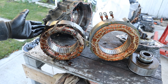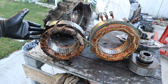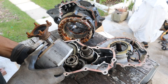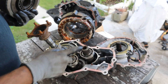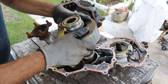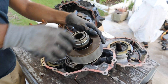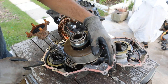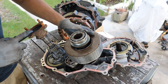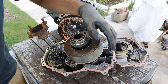MGR doesn't really do much in terms of propulsion — maybe a little bit on acceleration. Overall, you can see that this rear transaxle is quite under-designed; it's really just there to put an E all-wheel drive sticker on the back of your vehicle. MGR, represented by the rotor, turns a shaft which then turns a countershaft and then the final drive. If I start rotating, you'll see there is definitely a torque multiplication or a gear reduction — this motor has to spin many times faster than the rotation of the wheel, which is represented by this axle plugged into the differential.